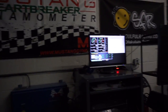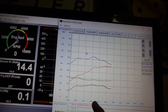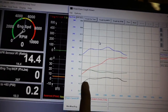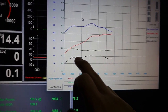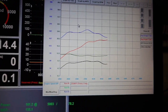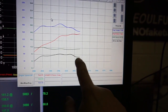Just been doing a few pulls here and there, going for the air-fuel ratio for now. It's only at like 10 pounds boost at the most and it actually tapers down a lot. This turbo actually spools up really quick — being a twin scroll, I thought it was going to be really laggy, but it comes in really quick. Full spool is at about 3700 RPM but it kicks in earlier. For a five or six hundred dollar turbo, I'm kind of impressed with the spool up.